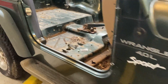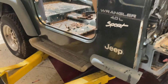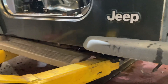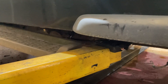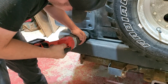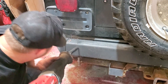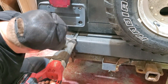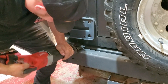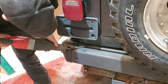We got the body mounts undone — some of them are really rusted. We got the lift under it and tried to lift it up. I was struggling to get some of the rusted bolts out. There are two bolts on the back of the Jeep tub that go from the frame member to the back of the tub and they were rusted in. It's a weld nut and the weld nut snapped — both were broken and just spinning. I had to cut both of them out, and getting the body off was just such a pain.